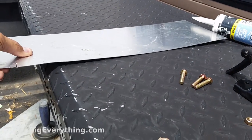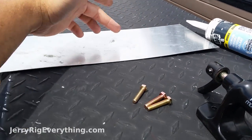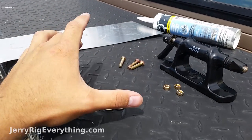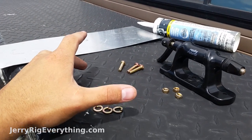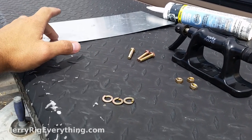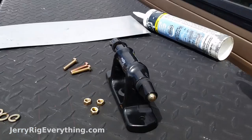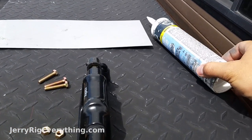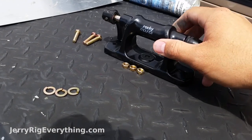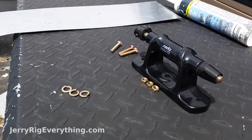I also have a sheet of metal that I'm going to cut, and then cut again lengthwise. This is going to be bolted on underneath with the mount so that if there's ever any rocking motion with the bike, it's not just relying on the thin top metal of the truck box — this metal will help support it if it rocks left and right. We're also going to use some clear sealer, which you put in between the top of the mount and the truck box so water will never leak inside, and the truck box itself won't rust.